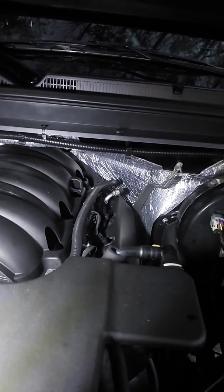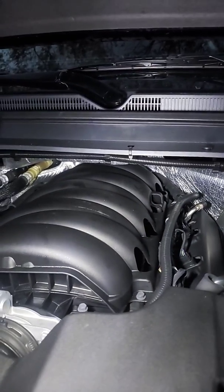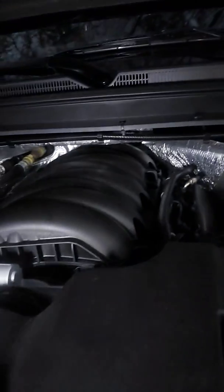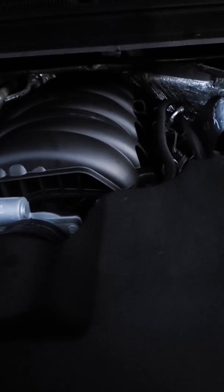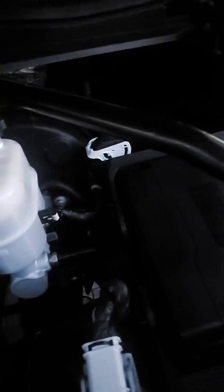Again, I soaked it overnight in some spray grease blaster stuff, and I was able to get the arms off. Each arm requires a different position of the hood to put in and take off. This, the one in the middle, obviously it's hood up. I put a step stool at the front of my truck here, climb up, and I just lean my big old body right across this, and I grabbed it with my left hand and my right hand, and you just rock it gently back and forth, and it popped up. And then on this side, I did the same exact thing.